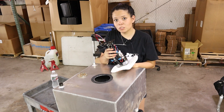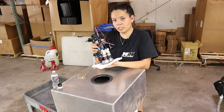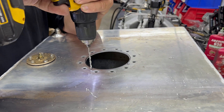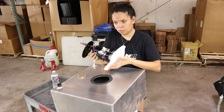Here we have the 12-volt fuel cell multi-pump fuel hat — it's got three 470s. We had to grind a little bit on the opening of the fuel cell so it'll fit and go in. We also have to line up the notches on the gasket with the holes we drilled, and those go in the middle of the notches that line up with the top of the fuel hat that has grooves.